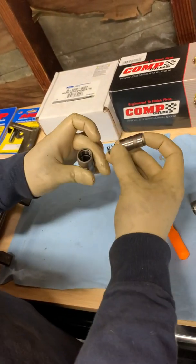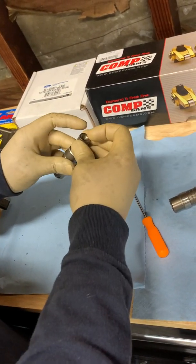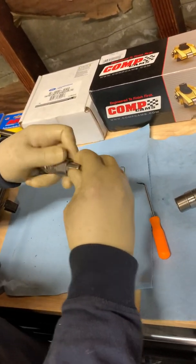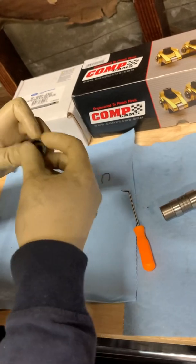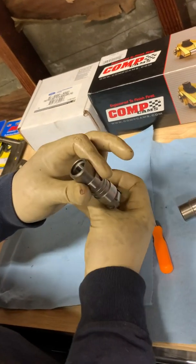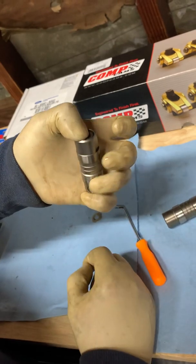Then you've got this piece that fits over the top, and your little clip that holds it all in place. So essentially what you could do is get a stack of washers, stack them up in there to remove any play, and then reassemble your components. Some people just reassemble the components upside down in a way to lock it — but I'm not a fan of that because it would make it sit proud and it doesn't look like it would sit correctly. So what I would do is just stack washers in there, drop this in, put this in so it's completely flush, and put your clip on so there's no hydraulic movement.